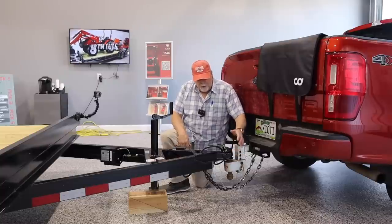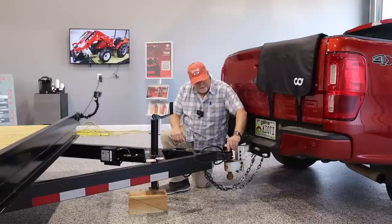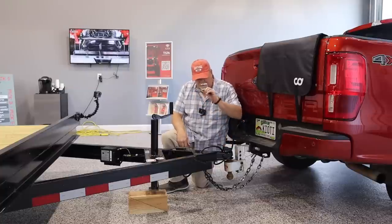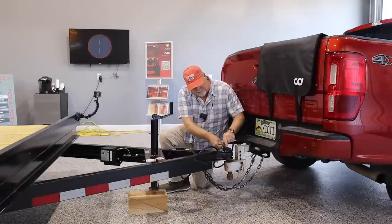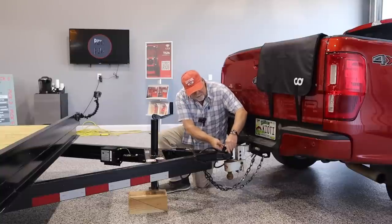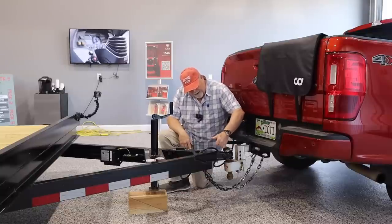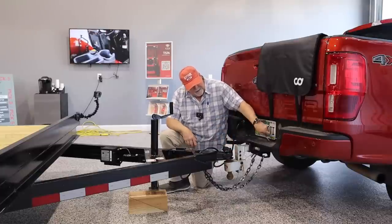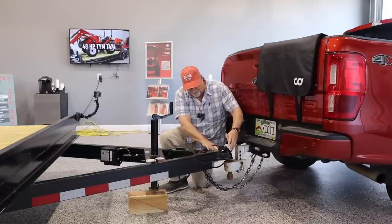Now, back to what I said. We're going to look at the individual components of what's on the tow vehicle and what's on the trailer. Hopefully your coupler is being secure. The final defense is the safety pin. Really it doesn't matter what kind of trailer you have, there's always one last thing that you can do, and in this case it's a safety pin looking thing, and it absolutely keeps the trailer from uncoupling. So take that off, take this off, slide it to the rear position. There's some indents to hold it open.